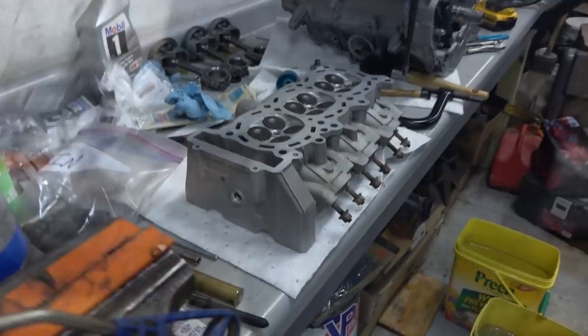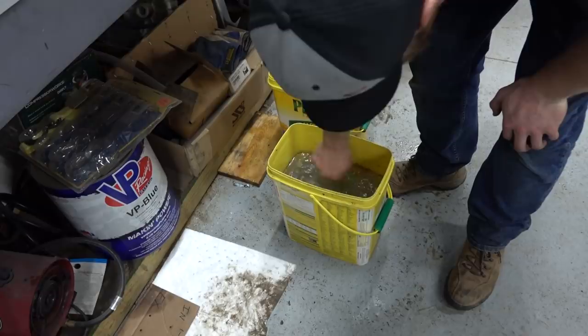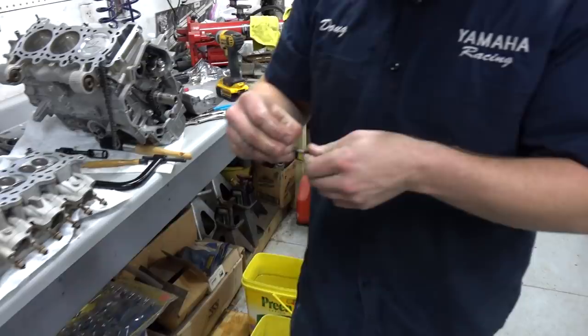It's time, man. We are working on the last valve. We got all the intake valves in, and Doug has every one of the exhaust valves except the last one. And this is the process. The last little digger. Clean it in the soap, a little soapy water, a little clean water. Make sure there's nothing in the groove for the keepers.